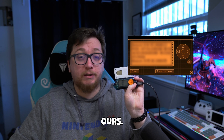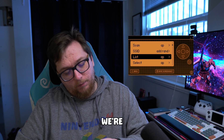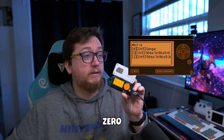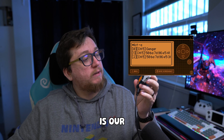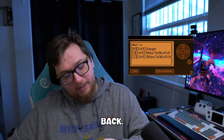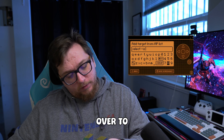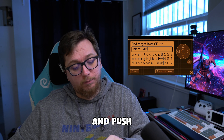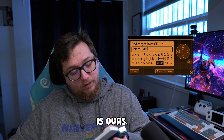I'm going to go ahead and hit the back button and see if we got ours. We'll just go ahead and hit back and check the list. Ours is actually right up there — number zero. It says channel five and zero is the number, so that is our Wi-Fi. We're going to hit back, then select AP and scroll over to whatever number it was. For our Wi-Fi it was zero, so we push zero and save. Now it says one was selected — that is ours.